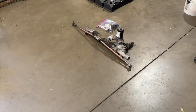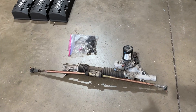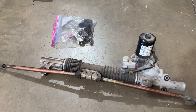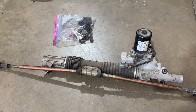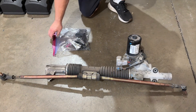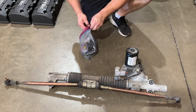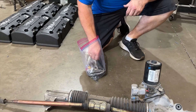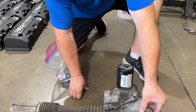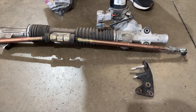That will free up a little bit of power, so some of the parts you're going to need is obviously the complete electric power steering rack and any hardware that you can get off the same car — EP3, again 2001 to 2005, like the EP3 with the K24 in it. The brackets are actually specific to the electric rack, so you're going to get all your brackets off that same car.